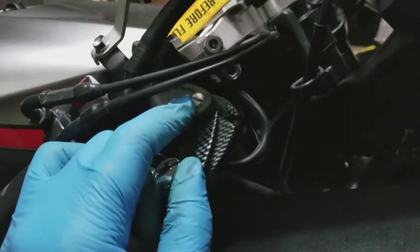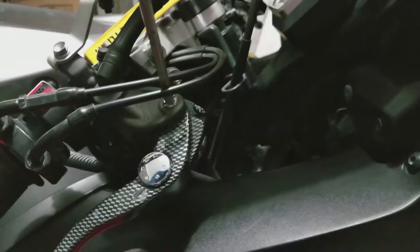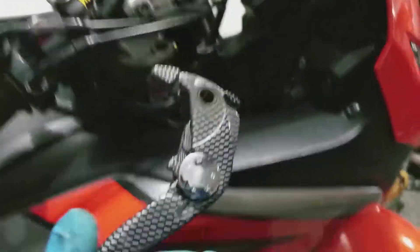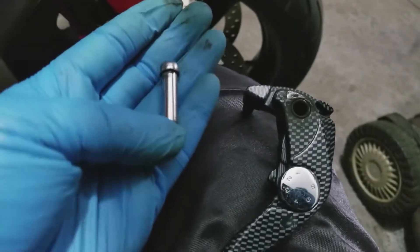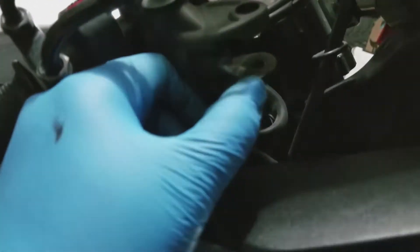Now let's get to the right side brake lever. I turned the handlebar just a little to clear it. It has the same 10mm nut here — broke that nut out. That's just to keep it in as a safety. It came out easy — super easy. Had a longer bolt on this side; I'll clean that up. It's a little dirty — that's the master cylinder piston itself.